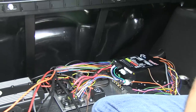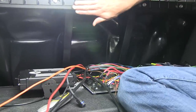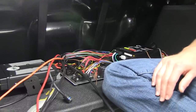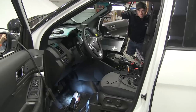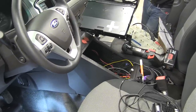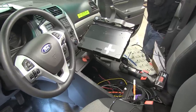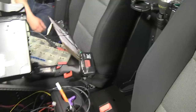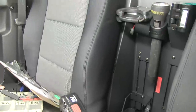A partition cover will go behind where the seat currently is — it'll come down and might have a slight bend so they can throw their equipment back there without it going anywhere near the electronics. Danny has got the console in and already into position. He's also got the Gamber Johnson components along with the MDT — in this case a laptop — in position as well. The gun rack is mounted, and the next step is wiring the gun rack, flashlight, and radio speaker, running those wires into the console.